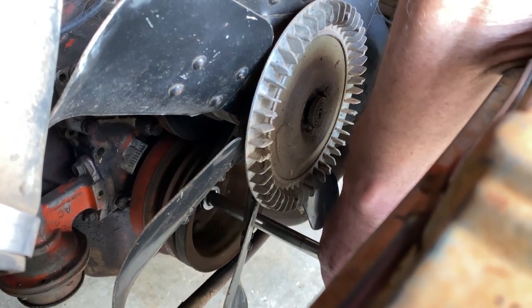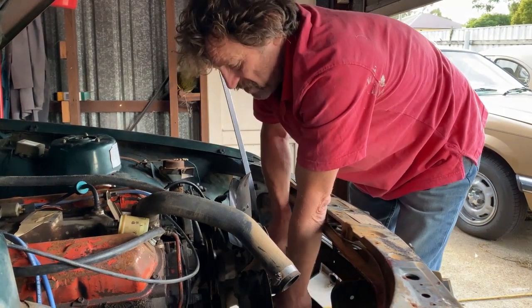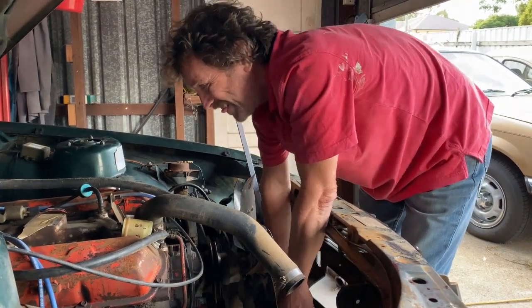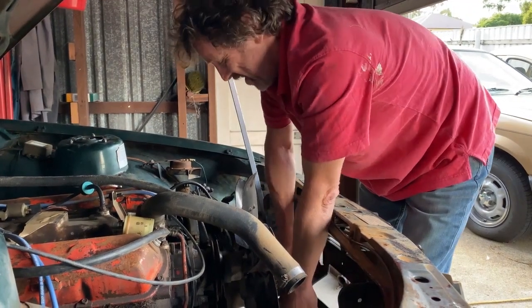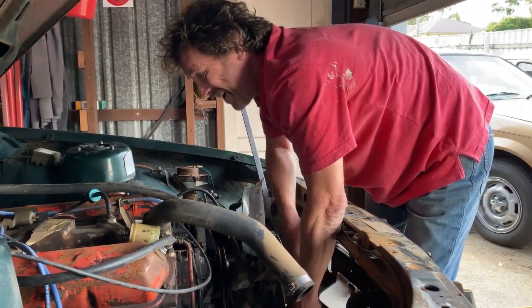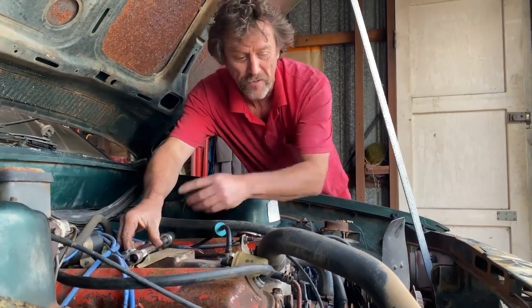Let's lock onto the front of the crank. Hopefully there's no grittiness, no horrible noises. You need to turn the engine over a couple of complete revolutions to make sure there are no big bad internal issues. Wow — that's pretty good. That is really good news. I can tell I'm excited!